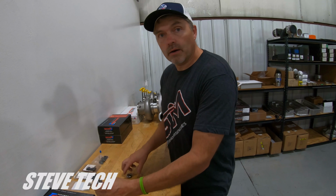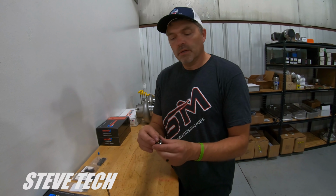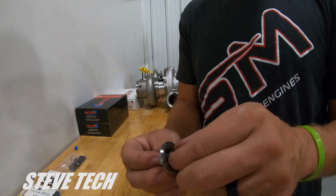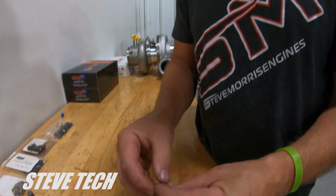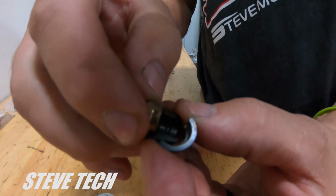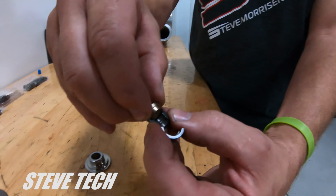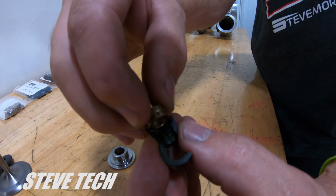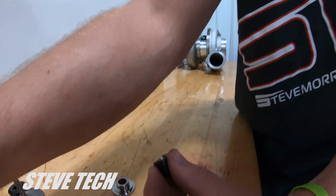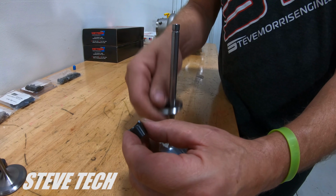Okay. What we're using now for what I feel is the ultimate setup is a sewer lid design. Now, this is hard to see here, but this lash cap is actually floating. See right there? It has a little ledge right there, and that is what captures it. So this lash cap actually fits in there, and when it's all put together on the valve, I'll show you on this SMX valve here. These are a little bit of a bugger to put together.